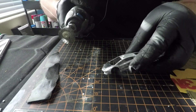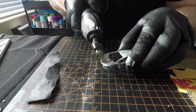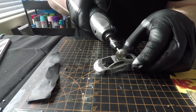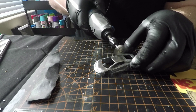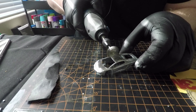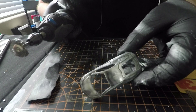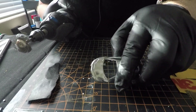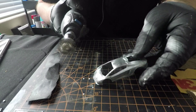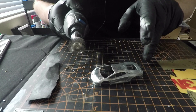I do like to use a Dremel with a wire brush to kind of speed up the process because we're going to have a lot of areas that are going to be kind of lengthy. So we're going to hit it with a wire brush and a Dremel - you're going to want to have a Dremel to cut back a lot of time. You just want to get the heavy imperfections off before you start Dremeling. This is a pretty good casting so we really don't have to do too much work on any pitting. Some of the bodies like the '57 Chevy are really pitted - 510s are pretty good. So we're going to hit this with a Dremel tool in all the hard to reach places. And then once we're done with that we'll hit it with 600 grit, 800 grit, 1000, then 1500.